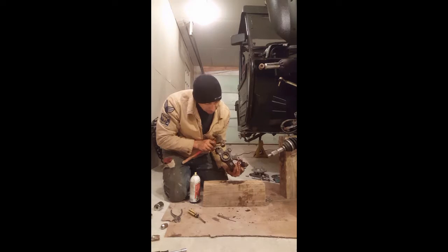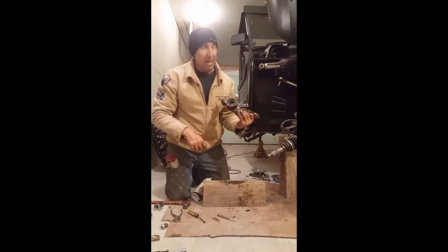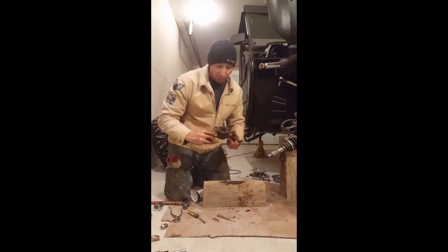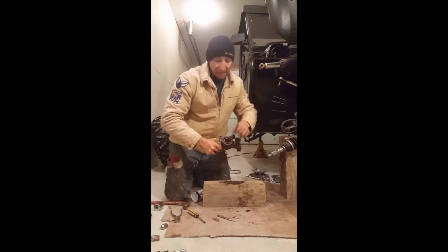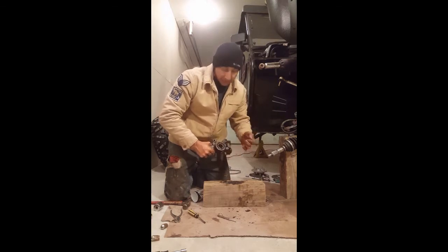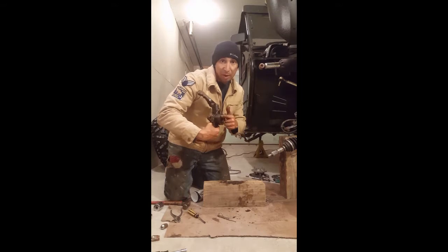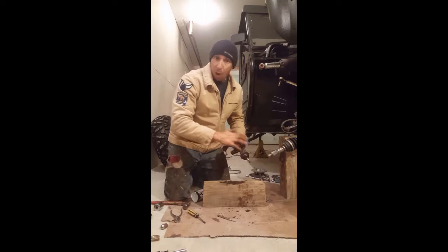Okay, so I am. Once you get yourself to the actual wood side, you're going to want to take this to your vise and set this inside the vise. And just keep punching that through. And then that bearing is going to pop out. And then simply turn it over. And now you got a lot of space to work with. Take your punch again, and that center piece right there, that'll just come out too. Don't worry about it, guys. That can go in either way. And then simply do the same thing on the other side with your vise. And pop that other bearing on each side and just work it out. It'll slide itself out, because you can see it's already flush on the edge there. So I'm going to go ahead and do that. And then I'll come back with this all cleaned out.